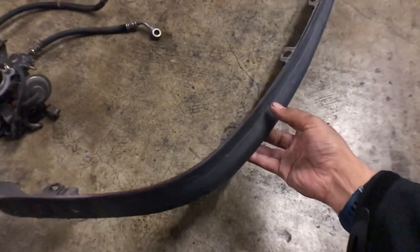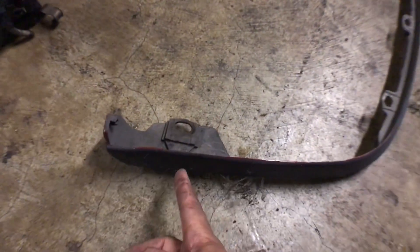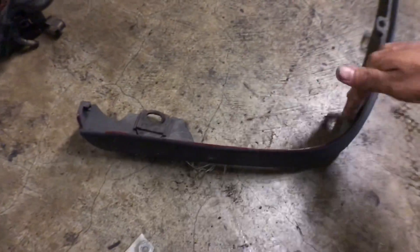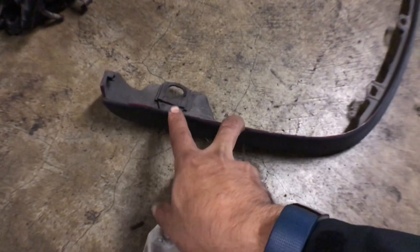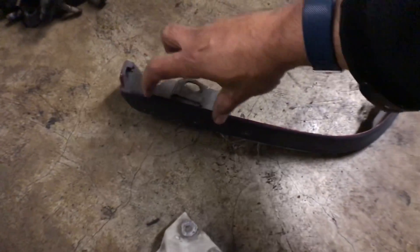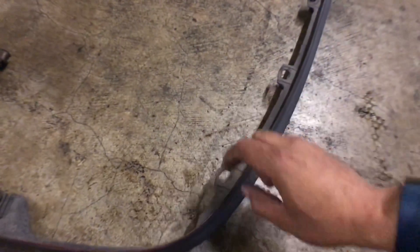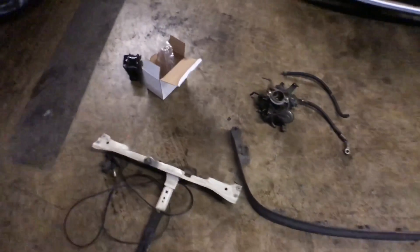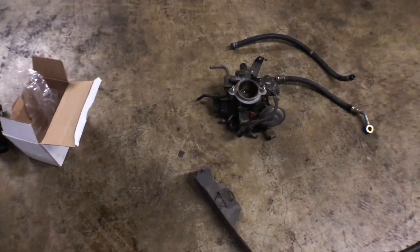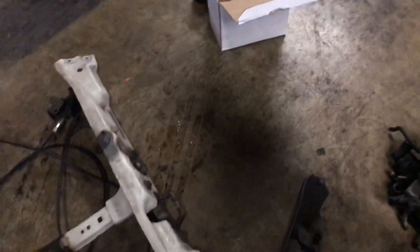I've actually put these on 88 to 91 Civics and they look pretty good. The only thing is you've got to chop it here because the DA9s go further out and the Civics have a shorter overhang on the bumper. I'm gonna end up cutting and notching it out, moving that piece over to get that little curve in there, then put some fiberglass on it. I got the hardware and zip ties — it's gonna look real cool on the CRX. I got more parts but they're not with me right now, so if you like this update on the CRX, like, subscribe, and comment.